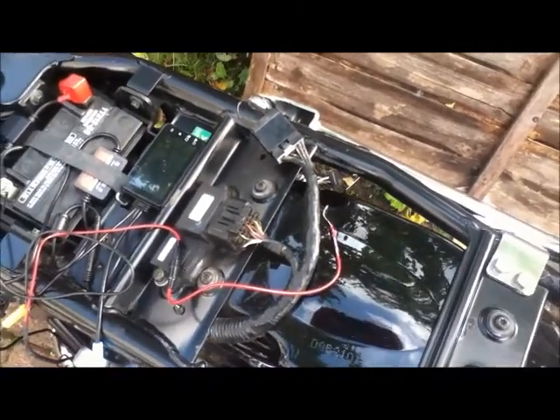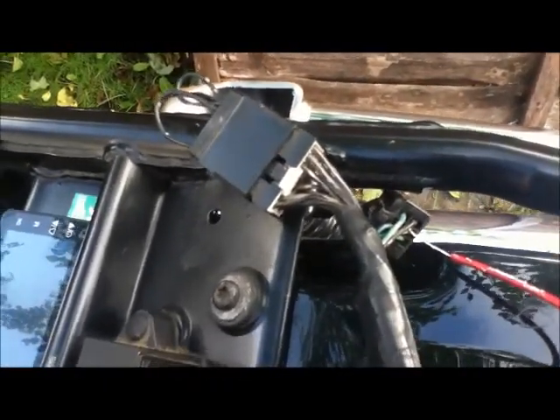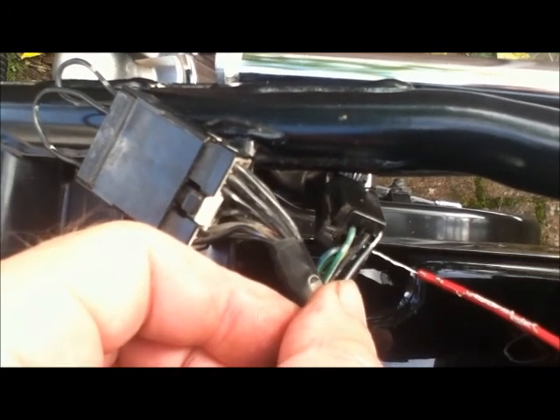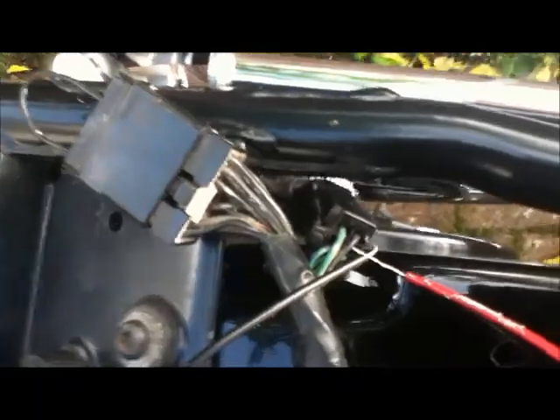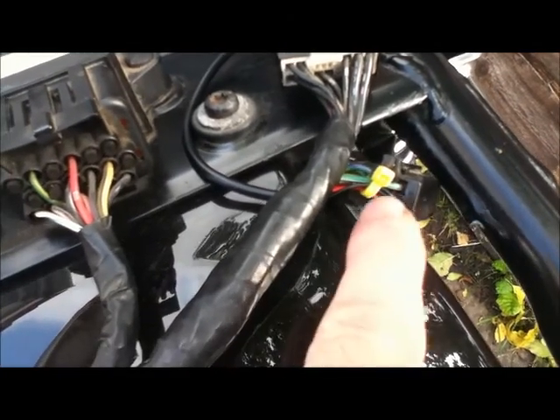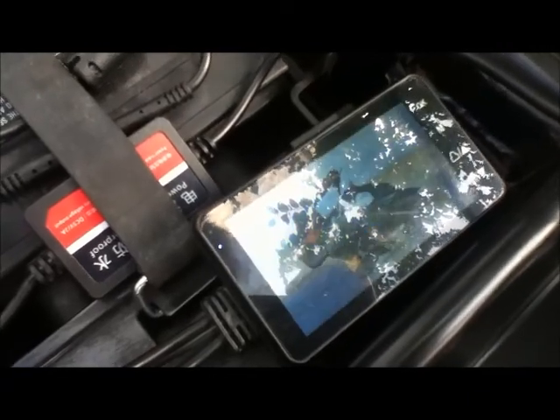I'll have the shortest amount of connecting cables and minimal intervention. As I suspected, the black one is the earth, so all I need to do is connect across that and it will fire up every time I turn the ignition on. I just push those bare ends into the back of the fittings, tape it up — job done and easily reversible. That's now wired in, held solid with a cable tie. If I turn the key, it fires up, and when I turn the key off, it shuts down after three seconds. Perfect.